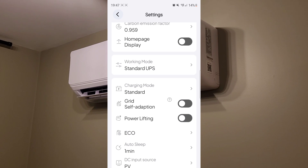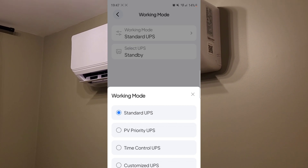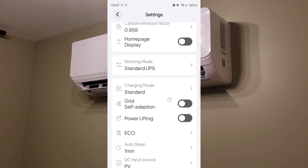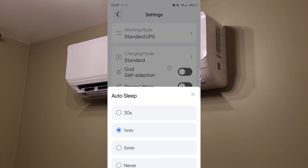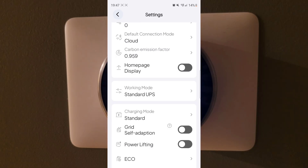You can set eco shutdown for both AC and DC independently. There's also a UPS mode — a really cool feature where you can leave this thing plugged in with something like a freezer or a furnace connected. If there's a power outage, it will automatically switch into UPS mode and your appliance will carry on unfazed, unaware that anything has changed. That's a great feature for a freezer, sump pump, or similar appliances. I'll probably do a dedicated video on that.